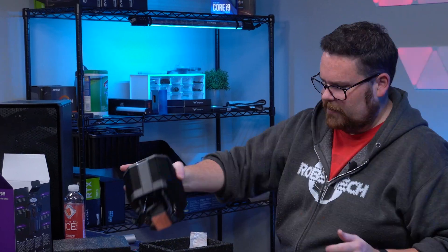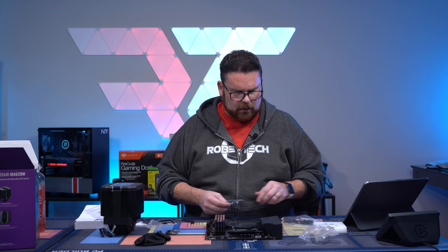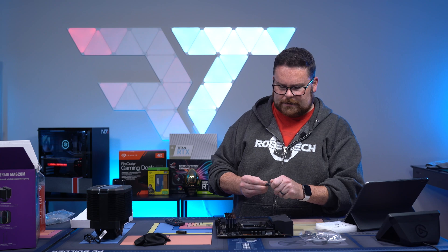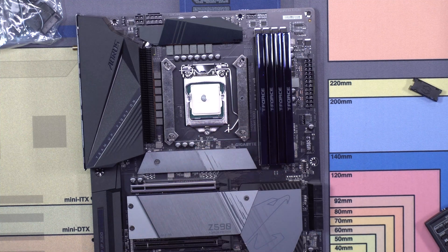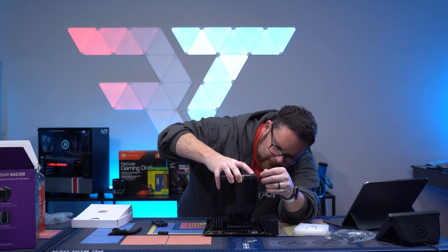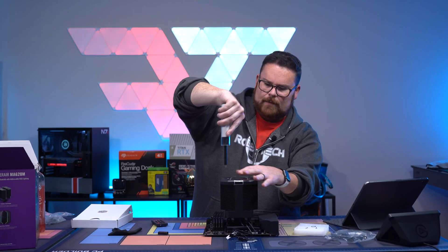It will work — it works! There's our Intel bracket right there. We're going to put this in and then grab our little mounting hardware. Next thing we're going to do is put some thermal paste on — a little Bob Ross painting action here. That thermal paste came out quick. Now we're going to get this massive cooler on here. So much cooler!